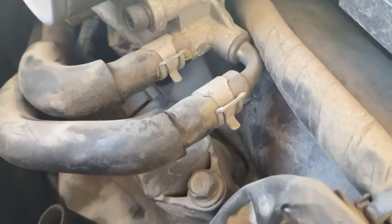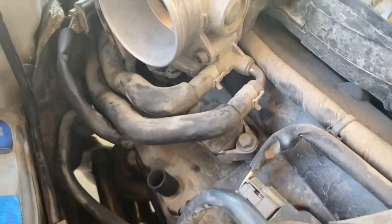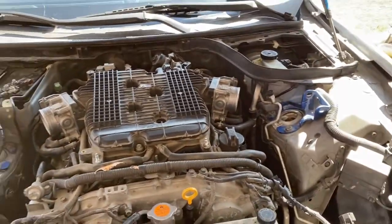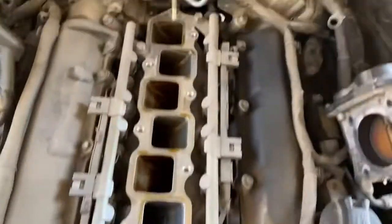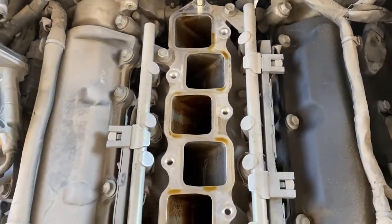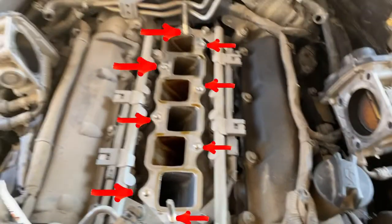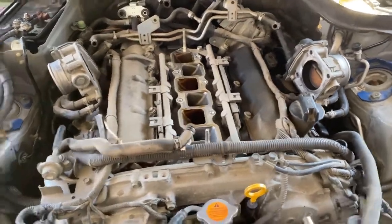And I'm looking at the throttle bodies and they're pretty dusty, man. Like, they look like if I try to take them off, they're gonna rip. But with that being said, let's get the intake off, and I'll make that decision as I go. All right, guys, so we finally got the manifold off. It's simply just 8 bolts down the center. 1, 2, 3, 4, 5, 6, 7, 8. Once you get those 8 off, you just pull up, voila.